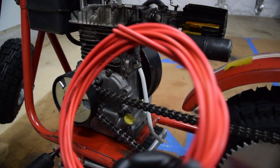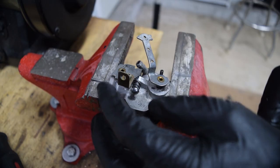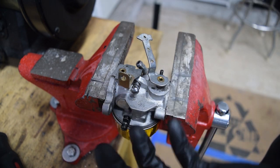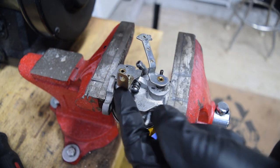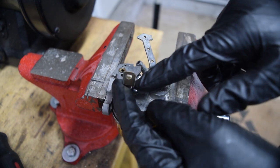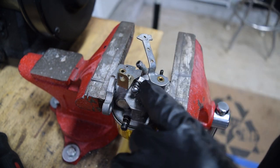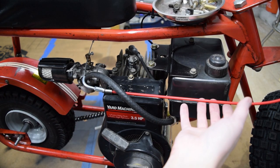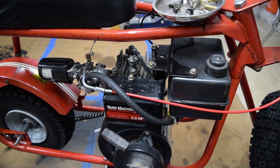I ordered a cabling kit that comes with two different sizes of cables for exterior housings, interior cables, and all the fittings. It looks like almost no work but it was actually a lot of work. I had to trim up the cable, mess with it a lot because it was too long and didn't go the directions I needed. I couldn't get the throttle cable through the linkage without it binding on the housing of the carb itself. I had a little 90-degree bend bracket, and even then I had to trim the bolt shorter and trim the housing to clear the nut on the underside. I'm really proud of how this turned out. All we have to do now is mount a return spring, mount the breather hose somewhere, and finish the clutch mounting.